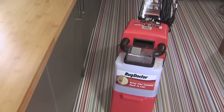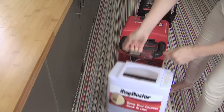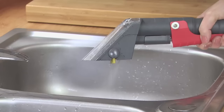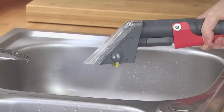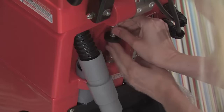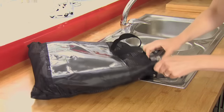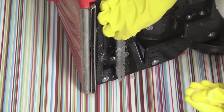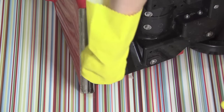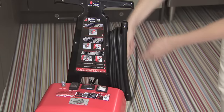As part of your hire agreement, which you signed when you collected the Rug Doctor, before returning it to the store you should prepare it for transportation. This includes emptying both tanks of any remaining water, otherwise it might leak out into your vehicle. Empty the recovery tank in the normal way. Empty the red bottom tank by using the hand tool attachment — hold it over a sink and squeeze continuously to squirt out the unused cleaning solution. Remove the hand tool hose connections from the bottom of the machine and reinsert the carpet cleaning hoses. Roll up the hand tool and hoses and put them back into the mesh carrying bag. Make sure the bottom of the machine is free of any carpet residue or other obstructions. The machine must be returned in a clean condition to the store.